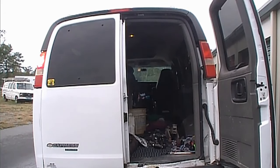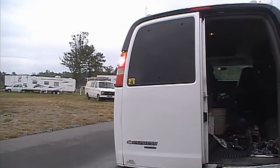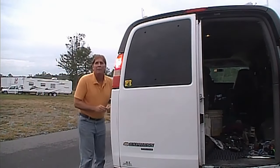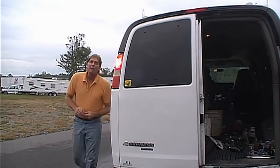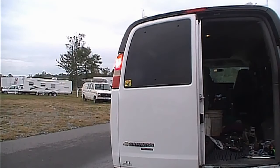That was a single chirp, and now our driver's rear light is lit up. We're going to let the air out of this tire for five seconds. If it learns this, it'll beep twice and we're done. Sometimes you have to repeat the process, which is not great, but we're after resetting that tire pressure monitoring system, so it's pretty great. Two chirps — I believe we have this. Let's go take a look at the dash.